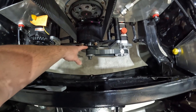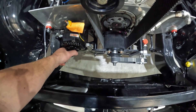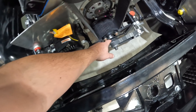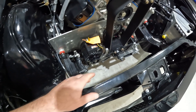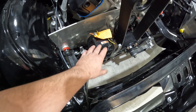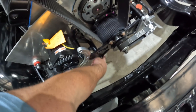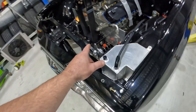I'm going to run the alternator off this v-belt, potentially just a little bit under-driven, and I need to make sure it's well and truly solid mounted because if that belt comes off, it'll flap around and push the other belt off, which is bad. I'm thinking of either mounting it here with a support to the engine plate, or possibly on the underside of the crank support setup where there's plenty of room. Not too sure yet.